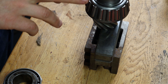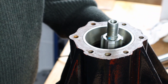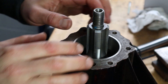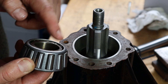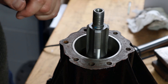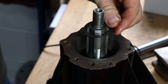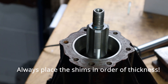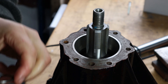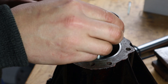I've turned the assembly over and I've now got my pinion shaft sat on some blocks, and that enables me to place the casing over it — allowing this to rotate whilst keeping this in position. The next thing to do is to set the preload. The preload is set by shims being placed between the bearing inner diameter and a step on the shaft. Shims come in various different thicknesses and they need to be clean. I'm going to start with two thick shims — this is all guesswork at the moment — and place my bearing in, making sure that the surface is clean.